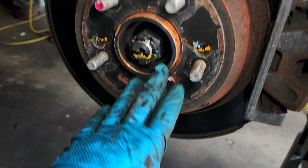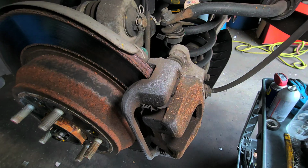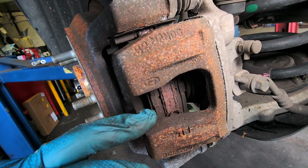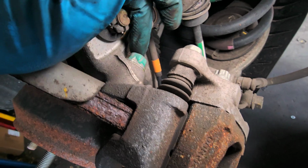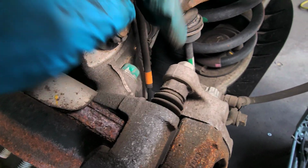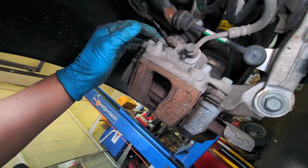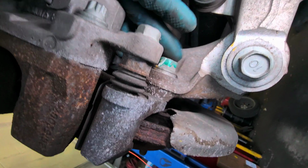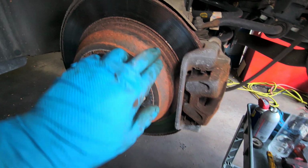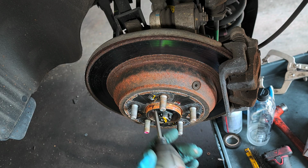This is gonna be the rear brakes, alright? Let me show you how it looks like. Two screws over here. Let's see. Nothing unusual. These are 14. These are 17. This is the one that holds the caliper bracket. There's another one over there at the bottom. Okay. Not this one's, okay? This one's. And then this one. The adjuster hole. Okay, there's a rubber right there. So we're Gucci.